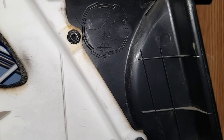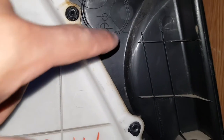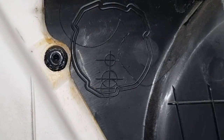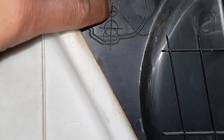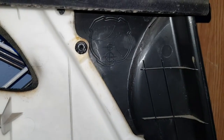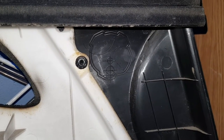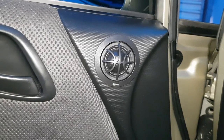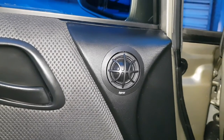As I mentioned earlier in the vlog, I'm also looking at replacing the factory door speakers with some aftermarket coaxials and possibly a sub in the boot as well. For anyone looking at fitting tweeters into their GE3, on the back of the driver side door card you'll actually see markings with a little cut-out — that's the position of the tweeter. I placed the hybrid ones just slightly above that mark because of the size of the tweeter, wanting it to sit as close to center as possible. If I'd put it any lower, the tweeter housing would have overlapped the edges, which I didn't want as I wanted it to look as OEM as possible.